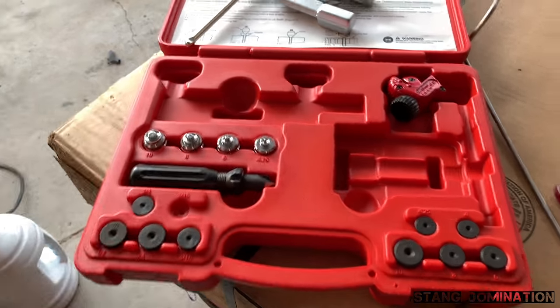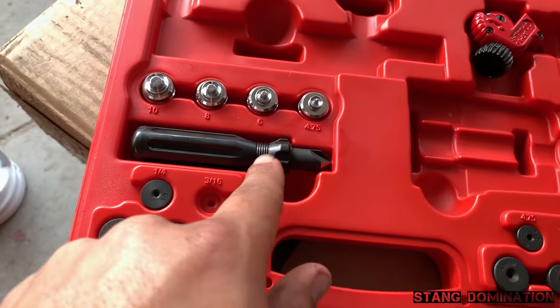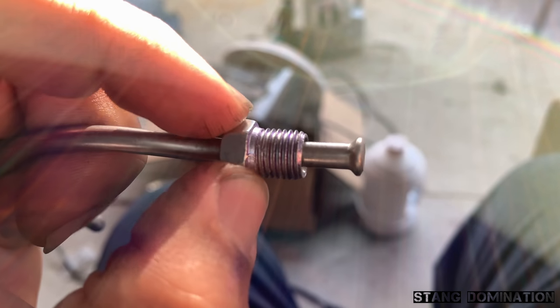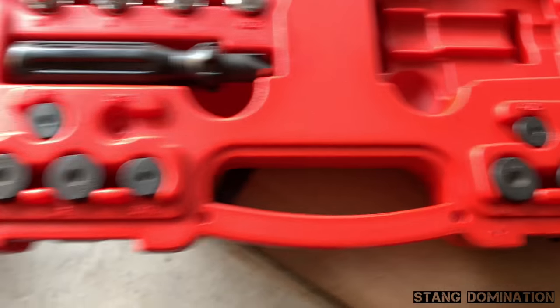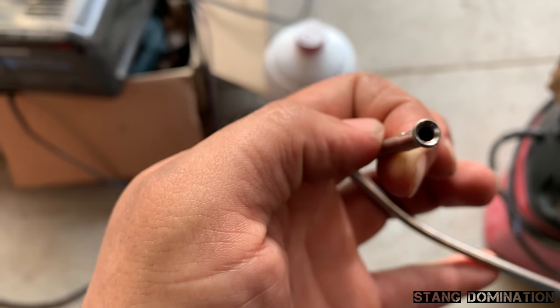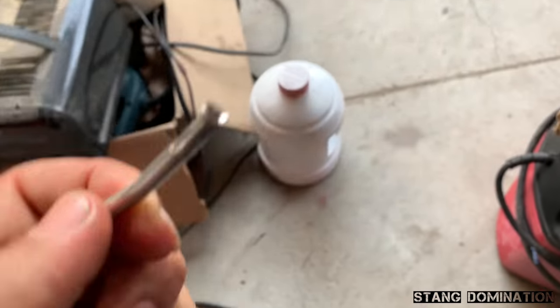So I'm practicing the flaring. Just bought this kit from Amazon — combined double flaring. Check out what it comes with: the little deburring tool. That works miracles, this kit works miracles. I recommend getting this only because I've been sitting here practicing on the flares. This is the factory one that comes from the classic tube — double flared. It looks pretty, looks great. The center looks all squared up. This is the one I did today. I need to get the 5/16 instead of the 3/16 or 4.75, which I mean it'll work, but it is a little tight so it kind of crunches it a little bit. It didn't do any damage — I already checked, didn't squash it. The other kit came with a little bit of lubricant — just lube up everything and it'll flare it out perfectly. When I took the other ones to the shop, he actually did this one right here. Mine came out a little bit better than his.